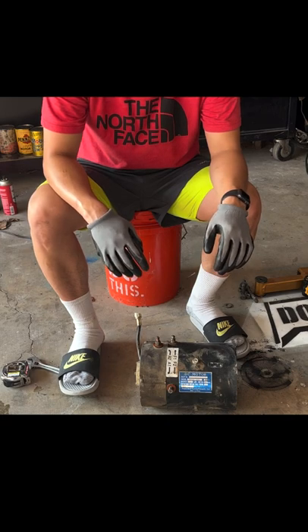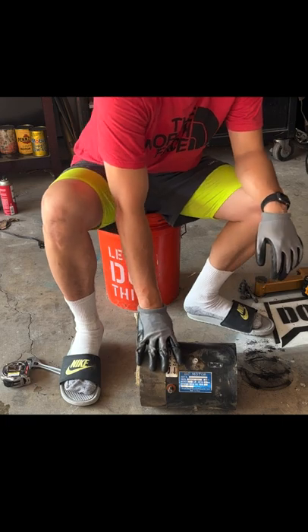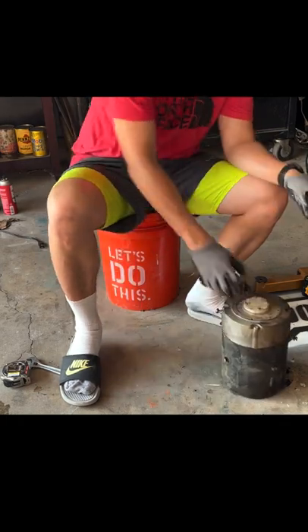It's a little bit of a click, so we're going to take this apart. I believe it is an electrical motor issue because look at all this carbon from the brushes. How these DC motors work is there's an armature, which is like the center part, and you'll see brushes. Let's just take it apart and I'll show you from there. See if we can't get this thing to work again.